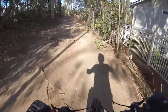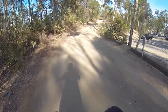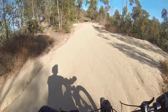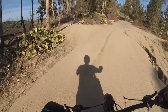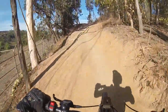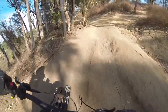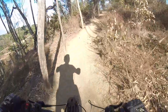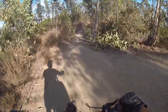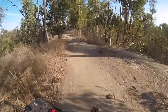So I've had this pedal kit for literally a week now, and I've done a couple rides here and there, done parts of this trail, and I can tell you now that you have two little pinch bolts on a smooth stainless spindle, so there is going to be slippage when you put too much torque on the actual cranks via human pedaling. And I don't really think that's a problem because when you're on flat ground and some inclines, you're still going to be able to propel it with human power and be compliant if where you're at requires the pedals to actually propel the bike. So I think that's good. Again, like I was saying before, if the freewheel fails, you're not going to have any issues with the crank spinning at 1,000 miles an hour.